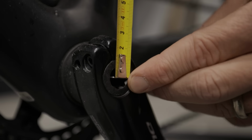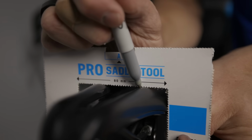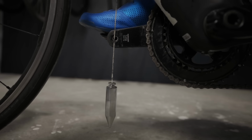So, takeaways. Standardize, standardize, standardize. Standardize your measurements. Always start from the bottom bracket. Always measure to the same place on the saddle. Not just the height, but also the fore aft. When possible, if you're transferring a fit, take the same saddle with you. If not, use your body's position in relation to the bottom bracket to figure out the fore aft there.